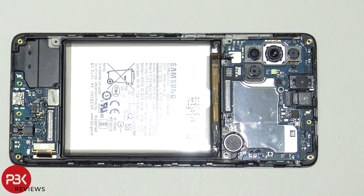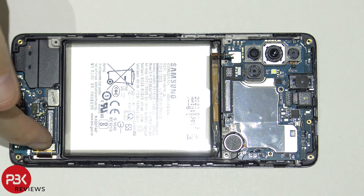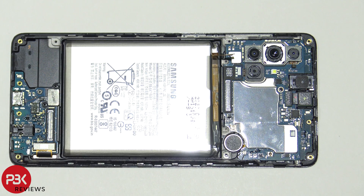As far as replacing the screen goes, at this point once you take the back off and disconnect the battery cable, you'd have access to the screen cable located over here. You just have to disconnect it, heat the front of the screen up to loosen the adhesive underneath, and then pry the screen off the mid frame. Apply new adhesive, get your new screen, run the cable back through the slit over here, attach it to the board, and reapply the screen on the front.